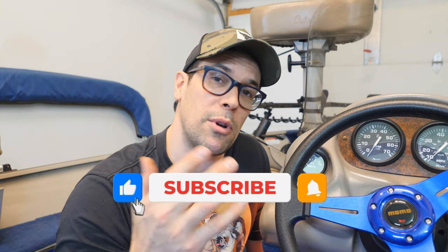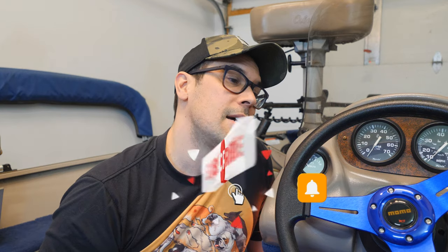A couple of extra notes: if you want to protect the bolt while you smack it with the hammer, just cover it with a two-by-four and hit that instead. And if you can't get it off, have somebody pull the steering wheel while you smack it — that can also help. Otherwise you might need a steering wheel puller, but probably only in extreme cases, like if it's been on for 30 years. This one was on since 2006 and it still came off fine. Make sure you hit that bell notification and we'll see if we fish, fix, or customize next time. Have a good one!